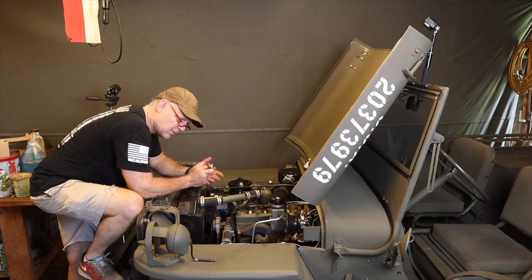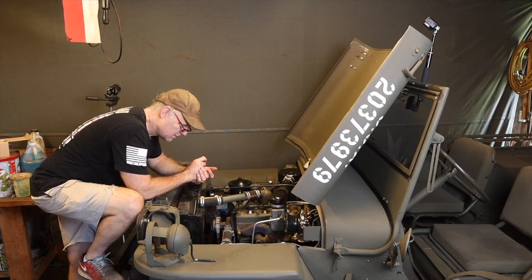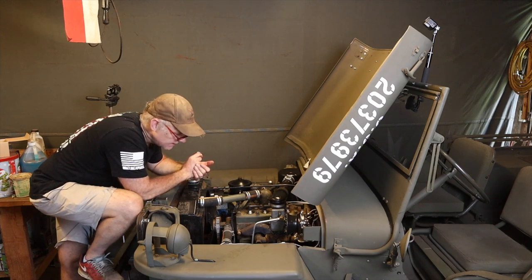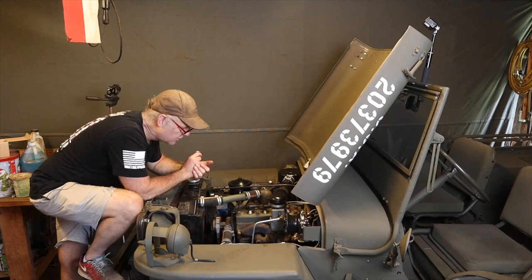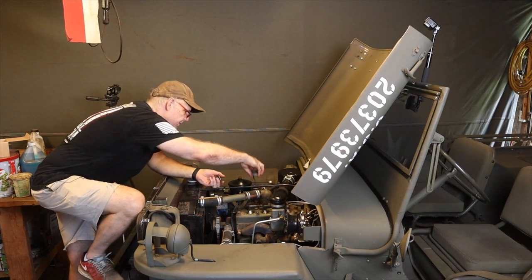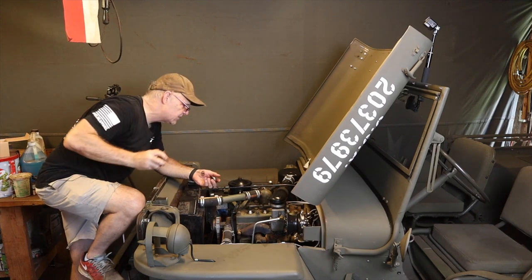And sort of the only other problem, I mean, I could have an engine problem, but the oil pressure is excellent. This motor only has about 200 hours on it. It came out of a generator. So I don't think that's the problem. I could theoretically have a problem with the head, and, you know, there could be a leak in the head or a crack that would be allowing exhaust gases into the cooling system. But usually if you have that, you get the other problem too, which is water in the oil and coolant in the oil, which makes for milky oil.